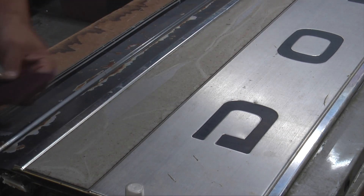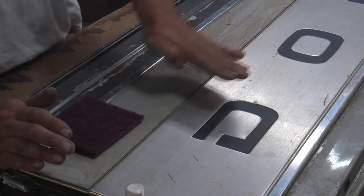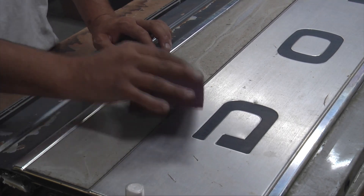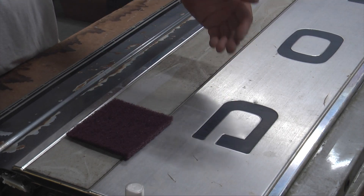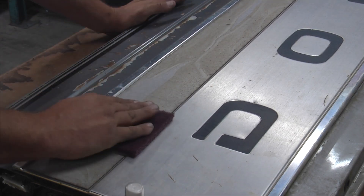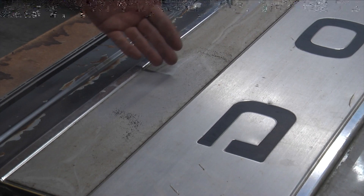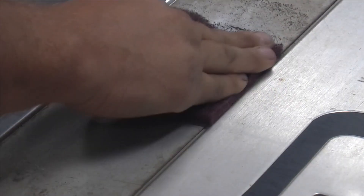First thing you want to do is address the texture. Take the more aggressive of the two pads. The key is that these panels were brushed from left to right, not up and down. These pads will create that same texture, so when you're using them do not go up and down, do not go in circles — you have to do a consistent left and right motion. This left-right action will slowly take the old surface off and put the factory grain back in, as if it had just come off the stainless machine. This is not a very fast job; depending on how much damage, it's about a 10–15 minute job to do the whole panel properly.